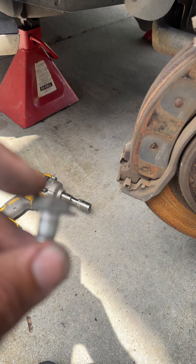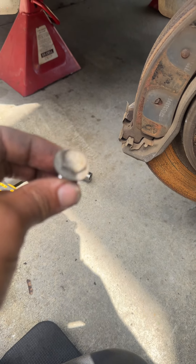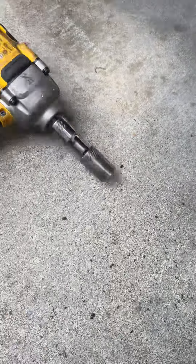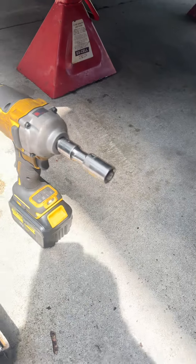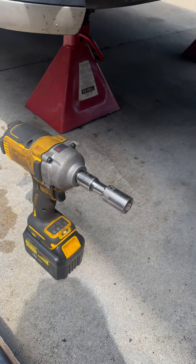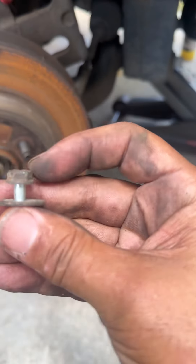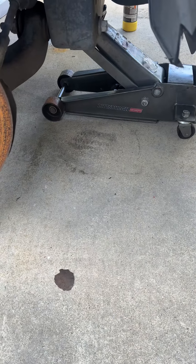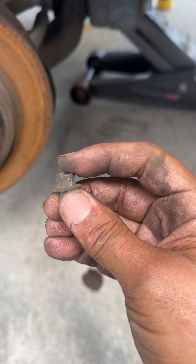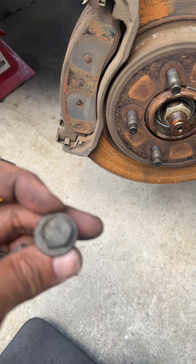As you can see how short they are, I was using just a regular ratchet and I was just rounding it off, which is not good. So what I did is I just took an impact wrench in the size of 17 and yanked it right off. So if you could buy an inexpensive Harbor Freight impact wrench — normal bolts have a good thickness to them, but Ford decided to put ultra thin ones that round off very easily.